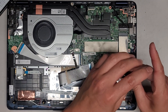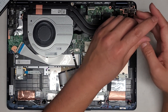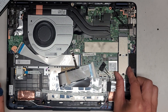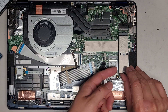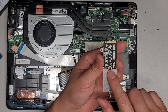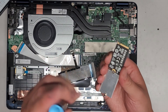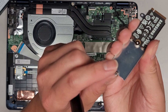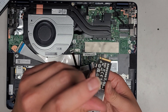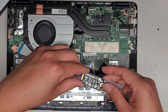I did clone it to another one in advance. There are two screws holding this thing down, and most likely this middle plate we're going to get rid of. We removed those two screws and it seems to be stuck — we're going to lift it up slightly and then pull it. It's stuck because the SSD is mounted here. We're going to undo this screw and it looks like it's held to this metal plate with a little plastic washer. Most likely we're going to use this to mount the new SSD onto the motherboard.